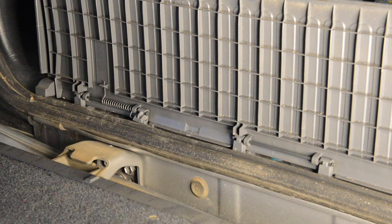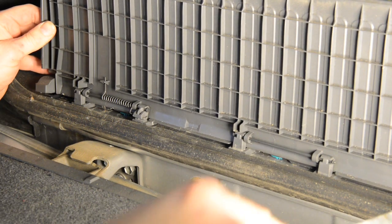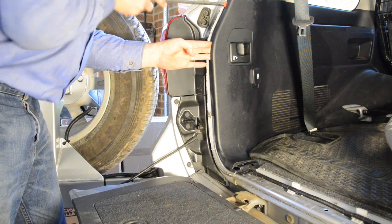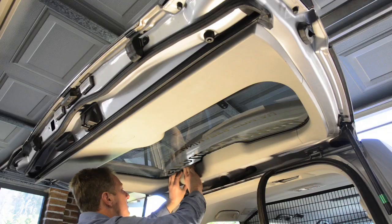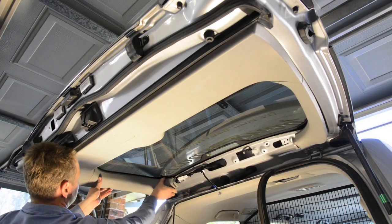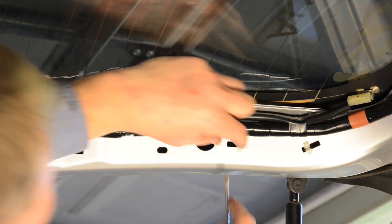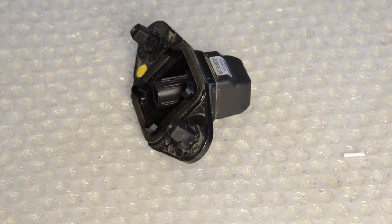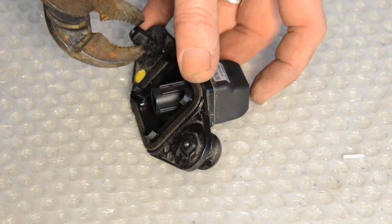It's now time to move on to the epic task of relocating the standard reversing camera. Begin by removing the plastic cover over the lower tailgate hinge by carefully levering the clips up with a screwdriver. You can then remove the door seal from the left hand side of the body. Next, carefully lever off the rear portion of the lower plastic trim from the left hand side of the load area until you can see the factory wiring grommet which goes through the floor. Moving to the upper tailgate, remove the four plastic trim pieces, starting with the upper section, followed by the two sides and then the lower section. All the pieces are just clipped into place. Note that when you remove the side trims, the clips remain on the vehicle and you'll have to remove them and refit the clips to the trims before you refit the trims to the vehicle. You can then unscrew the T30 screws retaining the camera — before you can remove it though, you'll need to squeeze the corners of the tricky plastic clips, but from within the tailgate.